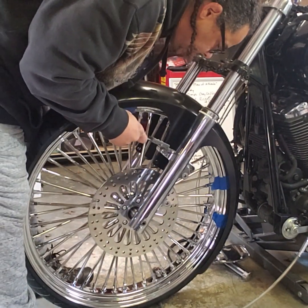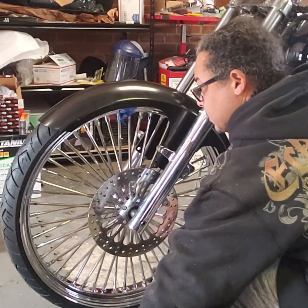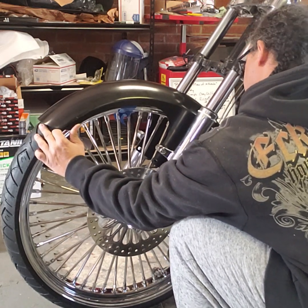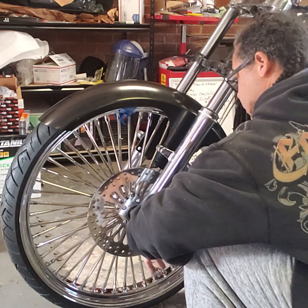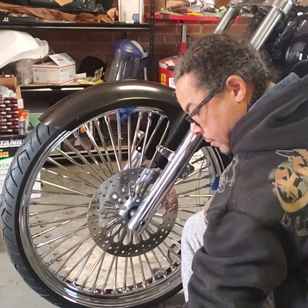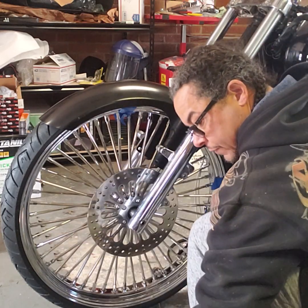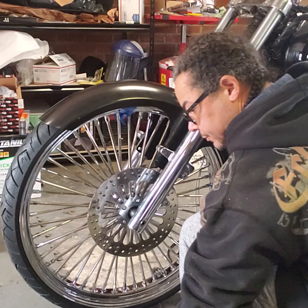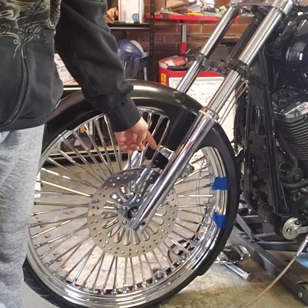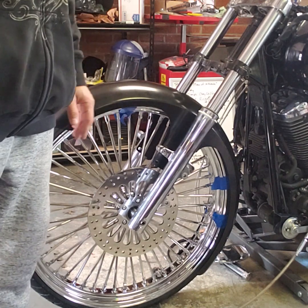Make sure we're at the same place on this side. And we are not, which means that the fender is actually twisted on the tire. And we were almost bingo. So I'm going to go with 0.4955 for my distance front edge of the adapter to the front edge of the fender mount, just to make sure that I'm square. That way I can go and cut and know that they are even on both sides.